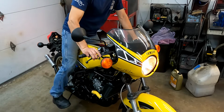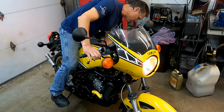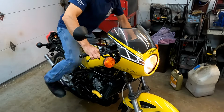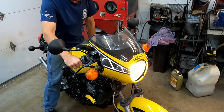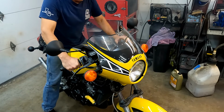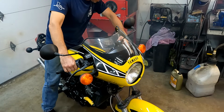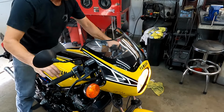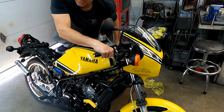Priming it. This is just priming it. That's off with the throttle wide open to get some fuel in the cylinder. Now I got it on. Choke. Obviously, the idle's a little off. That was between 2,500 and 3,000. But she starts. So now, tuning. Makes a huge difference.